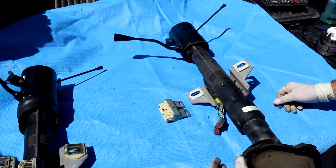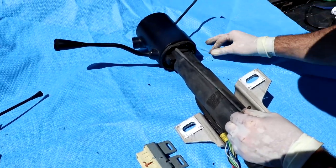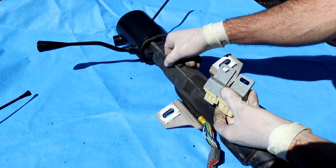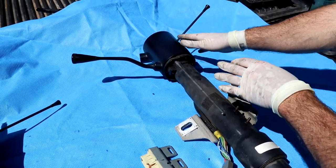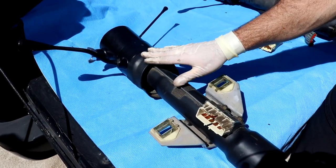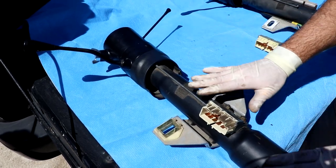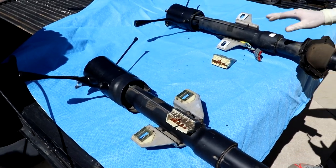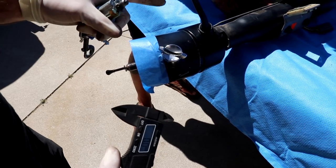This is the original column and something inside is broken or not connected — we swapped a part but that didn't solve anything because the key is still not engaging this rod. Rather than disassembling and doing a full rebuild, it's easier to go to the junkyard. Any F-150, Bronco, F-250, or F-350 from 87 to 91 uses the exact same steering column. For 50 bucks it's not even worth it to start messing around taking this one apart.